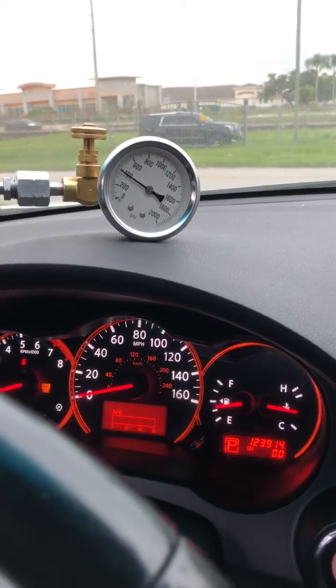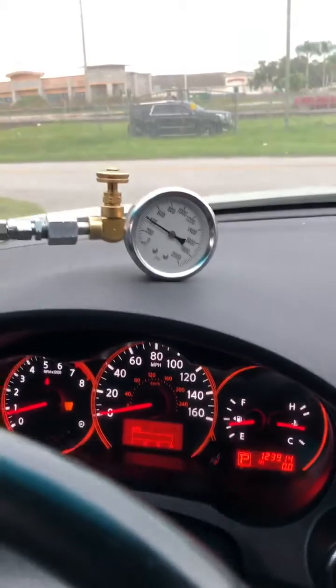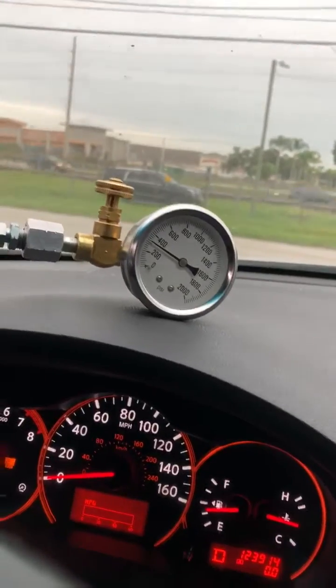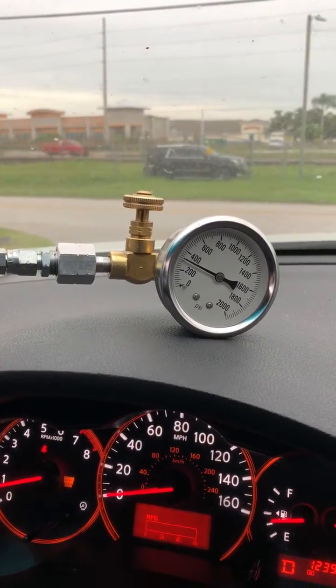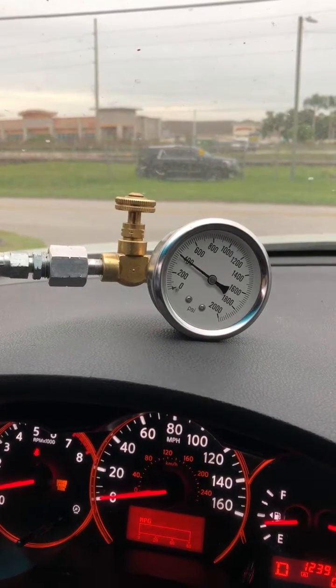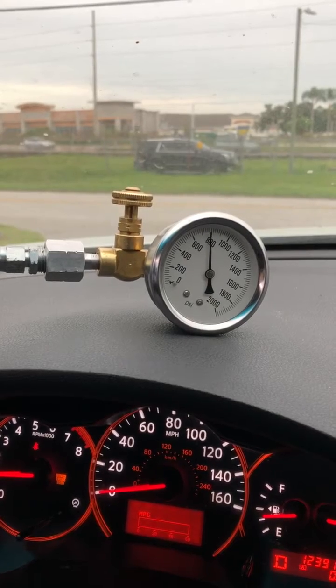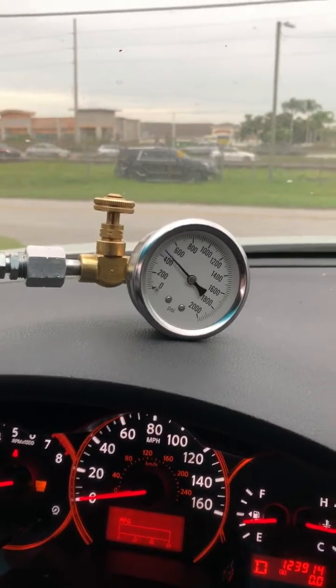Let's just accelerate, go for a test ride and see. We're gonna go ahead and put it in gear. If you see my pressure gauge right there, you want to have at least 200 or better — which we do. I'm gonna do a little bit of a brake torque. I got it in gear, I'm gonna bring it up. We should have at least 800 or better at 1500 RPM. So this transmission has got good pressure.